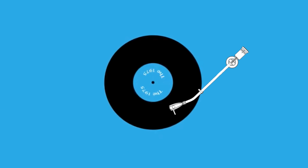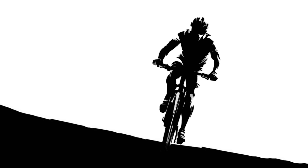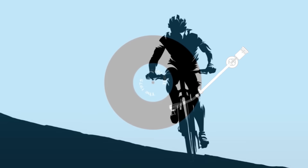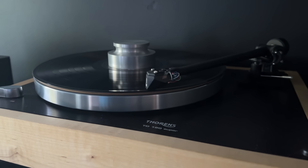When a record spins, a force pulls the needle toward the center of the record, causing it to lean too much to one side of the groove. This can lead to uneven sound where one channel sounds a little louder than the other. It can also result in uneven wear on the stylus because it contacts one side of the groove more than the other. Think of it like riding a bike on a slope — if it leans right, your bike drifts right, so you steer a bit left to compensate. Anti-skate works the same way, applying a little force in the opposite direction so the needle stays centered in the groove.